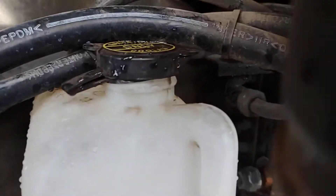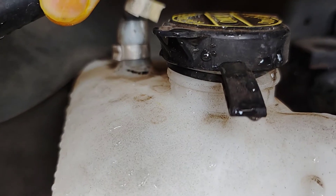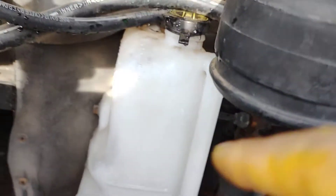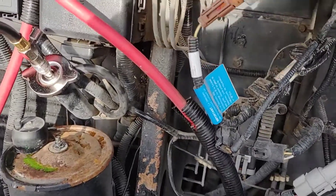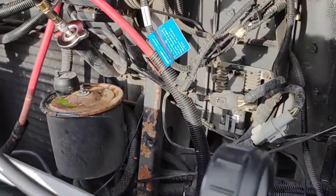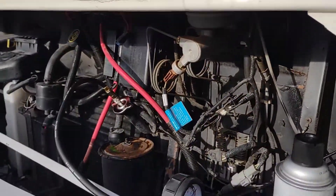The other thing I found is that the coolant overflow bottle has a crack in it right where the overflow line connects. I'll be getting a new bottle for that too. To summarize: check for leaks in the cooling system; if the system is good, just replace the cap and you should be good to go. Stay tuned for more videos like this with tool updates and Subaru fixes. Make sure you like and subscribe — this was a good video on how to pressure test your cooling system. Cooling system's holding — we're good to go, and we'll see you next time.